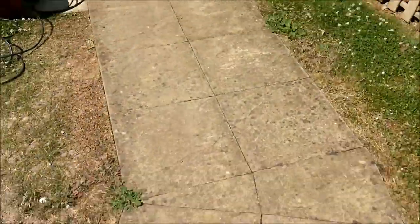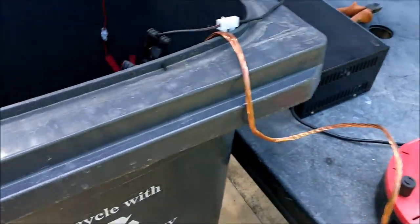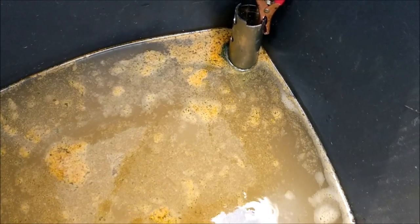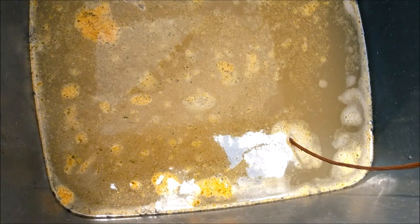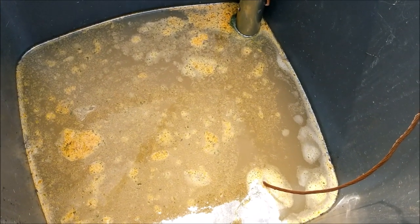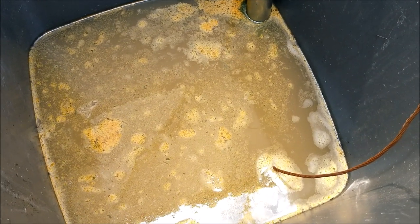See you later, alligator. Right, the solution has been bubbling away for half an hour now. What's going on there? Oh my goodness. Wow. I know, it's an old table leg. It's steel, so it's mild steel. You don't use stainless steel because it won't work. Look at that. That's proper going, isn't it? I'm just going to leave that in there, cooking away for hours and hours and see what happens. I'll check it after about 5 hours, I think, this evening.